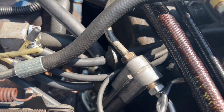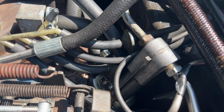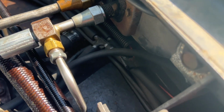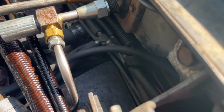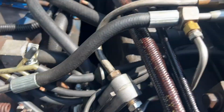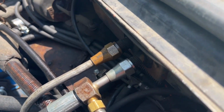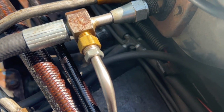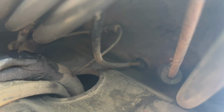So in this car, those two main lines, after they go through the one-way valve, go to these metal T's. There's two of them. They're made of metal, so they hold up very well, just like those two. You should never have to replace them. One of them, I don't remember which one, goes straight to the back of the ATC box, which is in the firewall here.